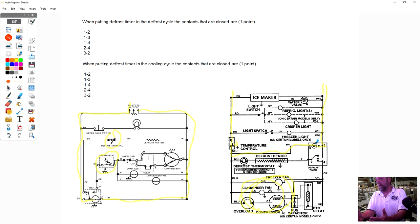And so when you open and close the refrigerator door and the thermostat says, hey, you have to turn the compressor back on, it's getting warm in here, now the timer's advancing when the compressor and fans are on. So we call this a cumulative run.